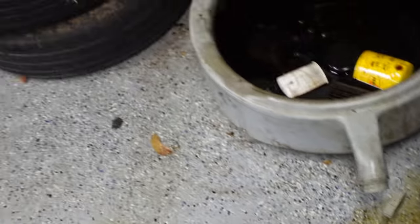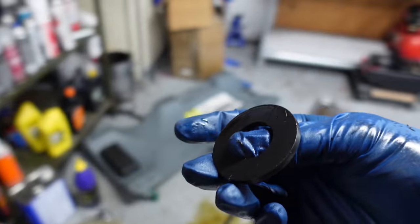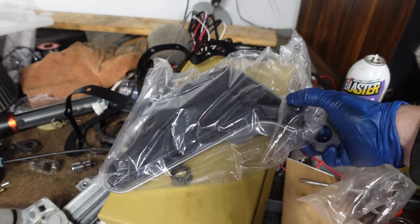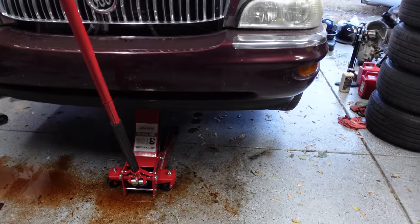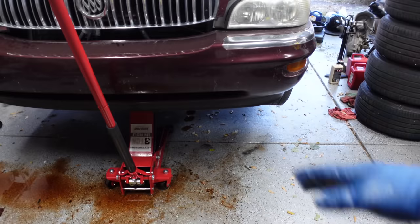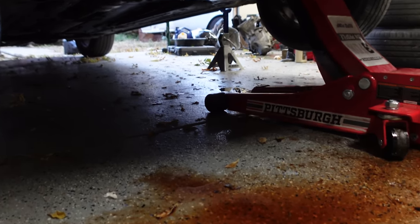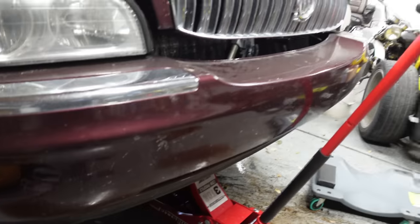I've also got one of these now — this is a General Motors TSB magnet. There's actually a technical service bulletin to put a second magnet in the transmission, and this one attaches to the filter. So this will just stick on there and now we've got that sorted. I've got the car jacked up — don't worry I do have jack stands. Let's get this thrown back in there. We're not really doing this on a lift so I can't really show any of that — I'll just go get it done.